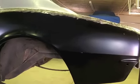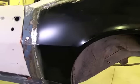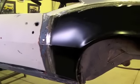All the welds are done underneath here and all the welds around the wheel well look good. I went ahead and put some seam sealer over the joint there since I had it. It's definitely not the quality of the AMD panel — it's got a couple of waves in it right out of the box — but for the most part I think it'll be pretty nice. Once I finish welding it, get the pinholes done, and the rest of the grinding done, then just do a little bodywork on it, it should look pretty nice.